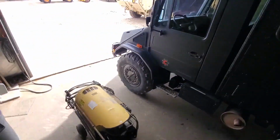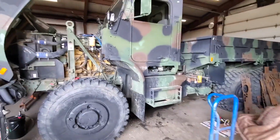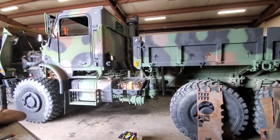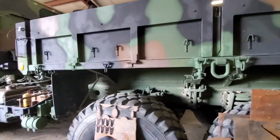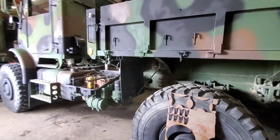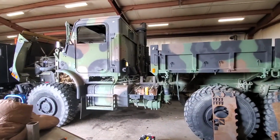Not easy, but at least it states everything you need to on a door placard, which is better than many manufacturers out there. So pay attention to that one, guys. Those modules are not inexpensive, and you could do a lot of damage by just doing a quick weld. We won't even tack weld on the truck. How these things are supposed to be EMP shielded is interesting, if they're that susceptible to weld current, but that's not my forte to understand, and it still makes me a little nervous. So all right, good luck.